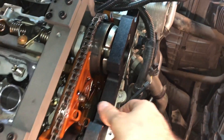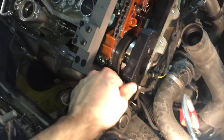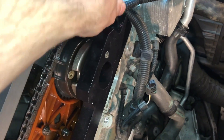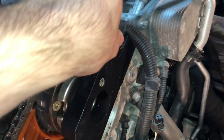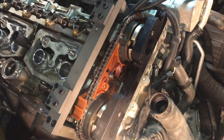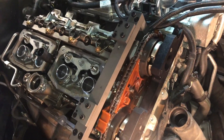This part is now installed — I screwed them in. No gap here, no gap there, everything lines up. Now I'm using the second part of the special tools. This has the little knobs to go inside the timing wheels. I'm going to use the two screws to keep it in place. At this point we're done with checking camshaft timing. As you can see, everything looks good — everything fit, which leads me to believe that the engine is in timing.